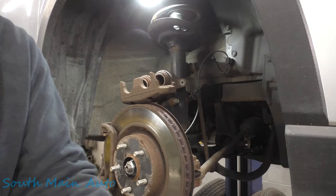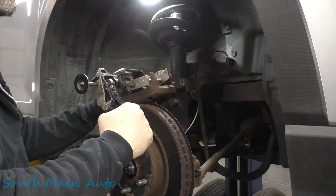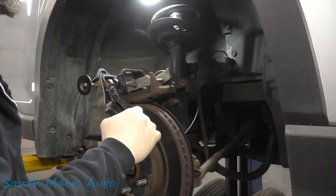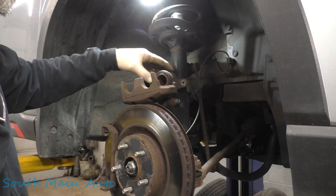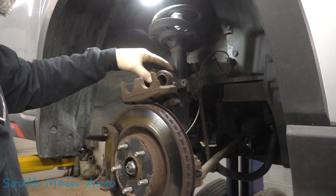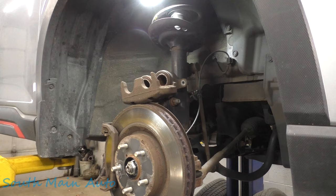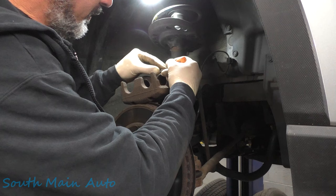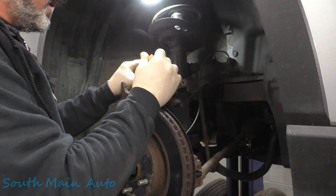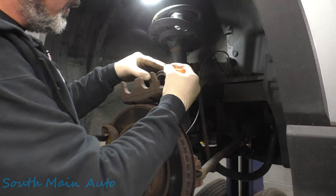Now that we have the big chunks cleaned off, it's a lot easier to do before you push the pistons in. We're going to push them in — you can use channel locks, two pairs of c-clamp vice grips, or a little caliper pushy tool. There's a little bit of air in the boots. Sometimes you can just pick them up with your fingers, but these ones are holding the air. So we'll come at it with a bent screwdriver — keep it pointed towards your piston and work it right under that lip of the boot where it hooks onto the piston. Push it back — you can see it get down in the crack — what I call 'burp the baby.' Just pick it up and let the air out. You'll see the boot suck in.